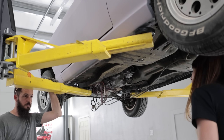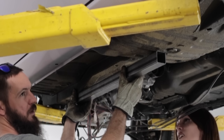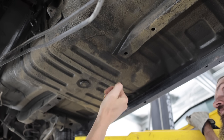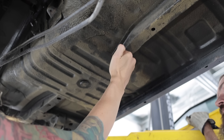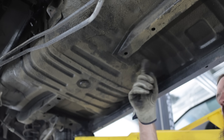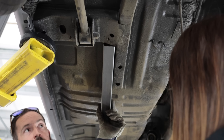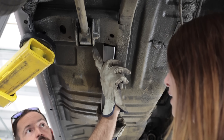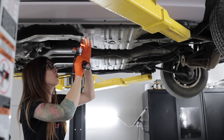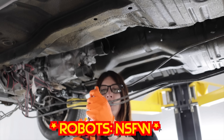Now that's cut - what do you think? It's skinny enough that it's going to perfectly fit. You're probably going to have to whack it in with a hammer, but it'll fit between those two. So we can actually find this since you can't see it on the top side of the car - if you were to drill a hole right here, that would give you an idea of where center is on this guy. Then you can use the body saw and cut it out to the sides. For those of you with a stepper bit fetish, this one's for you - they come in handy.